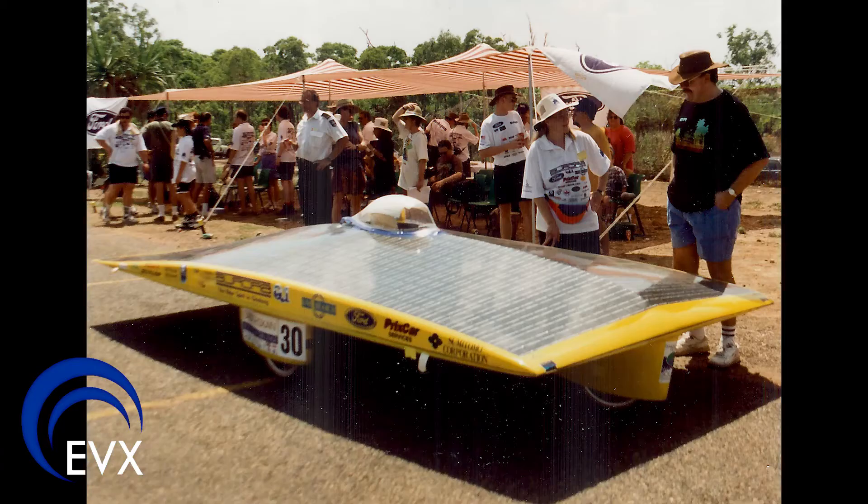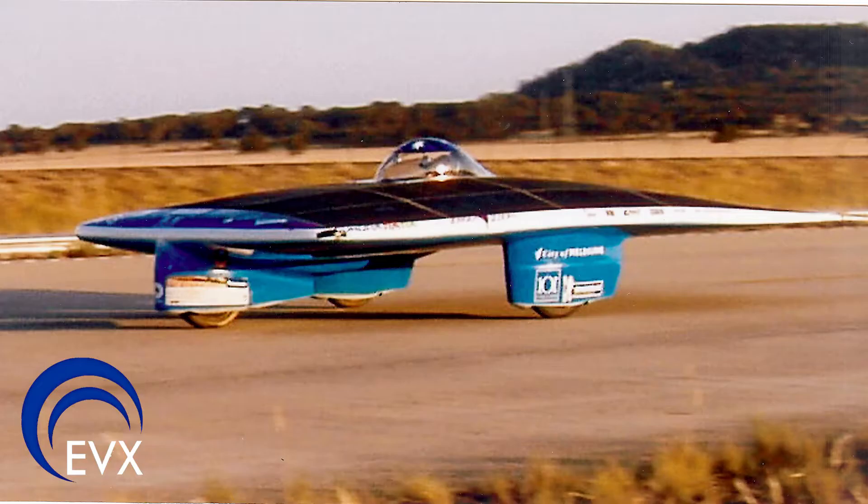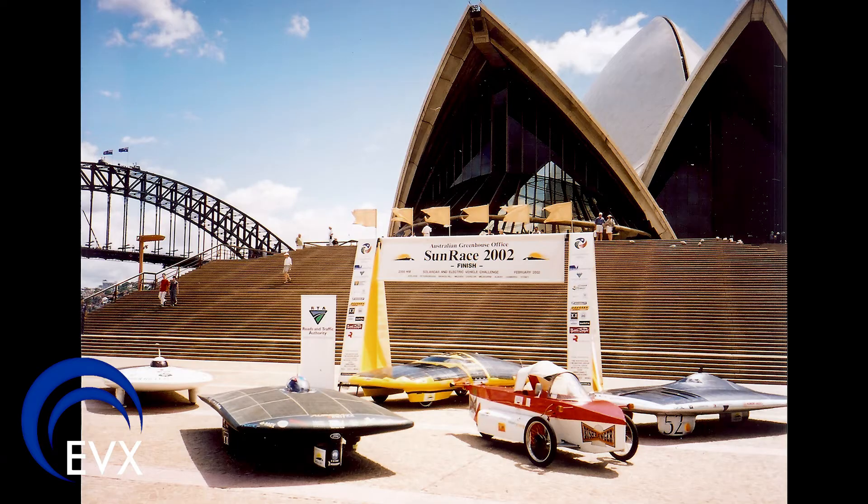If you look at a typical solar racer, they are incredibly slender, and we needed to get a CDA of around about 0.21, which is very low by most commercial car standards. What a lot of people also don't realize is that when it comes to solar car design, you also need to maintain particular cell alignment. So the real challenge has not just been coming up with a shape that is aerodynamic and stylish, but it's also constrained by the alignment of the cells.